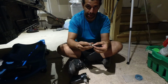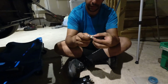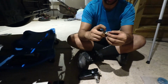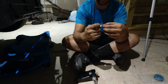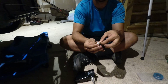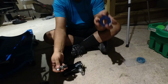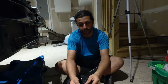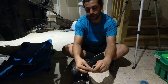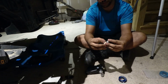The second important thing is that the Teflon tape cannot be covering the hole like this. If that gets into your fluid, it will clog things. So make sure that you run your finger on it. You're going to give it about 2 or 3 full revolutions, and we've provided you with a full roll. This will be more than enough, and you will never go through this for the turbo kit. So, Teflon tape is put on in a clockwise fashion, not covering the hole at all.